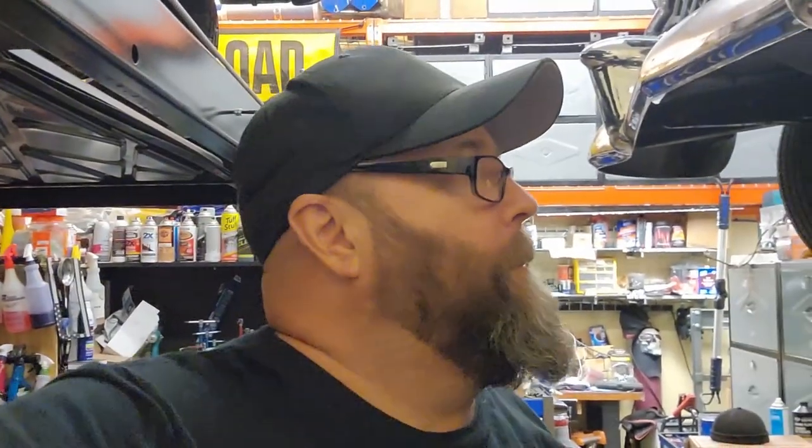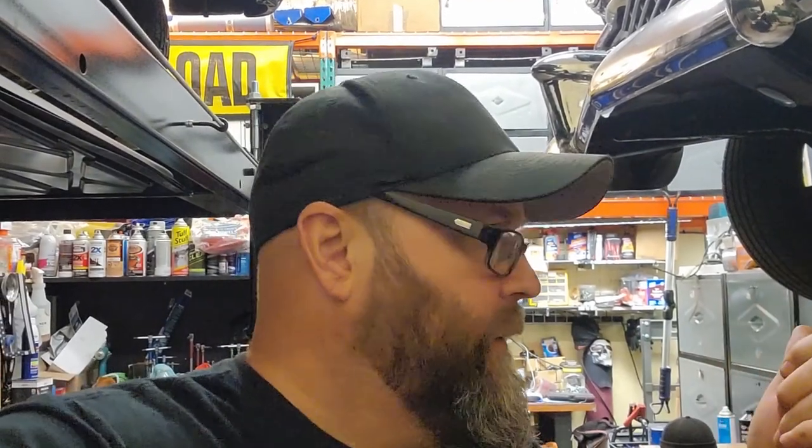Because what they make is a power control valve to manual. The manual, factory manual steering, doesn't have that end. It's solid, one piece. But it still has the spring loaded, like I was talking about, that I thought was adjustable. A ball that sits on the end of your idler arm and goes in, and it's clamped on both sides, and it's spring-loaded, and it kind of holds it. Again, I'm assuming it's to take out some of the jarringness, make it more comfortable riding these Belairs. Back in the day, technology.